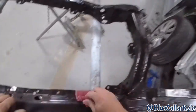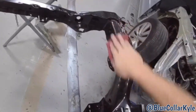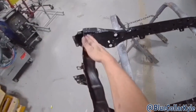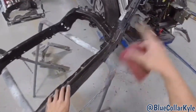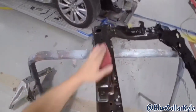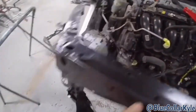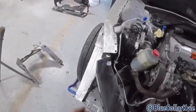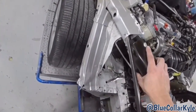I like to scuff these up for paint before I put it in — just makes it a little easier once it's all welded in to get to everything. Our paint department will actually paint these before I weld it in and then just go back and touch up the spots where I weld. They don't have time for that right now, so I'm going to get it welded in and they can come back and paint it later. These radiator supports are always a little tricky to get in because of the angle of these upper rails and the way it has to slide together, but you can get them in — it just takes a little bit of prying and they'll slip right in.